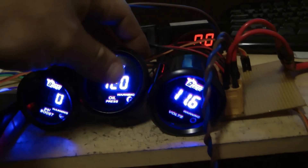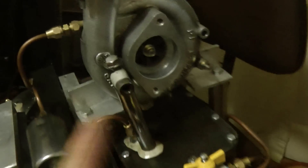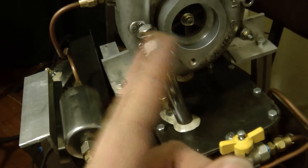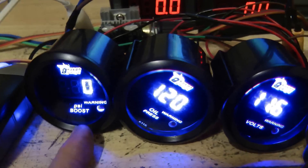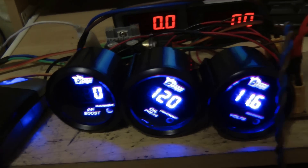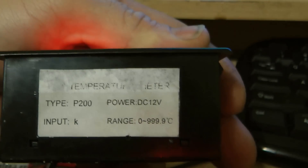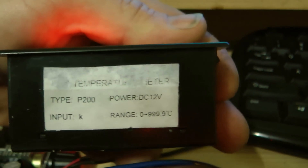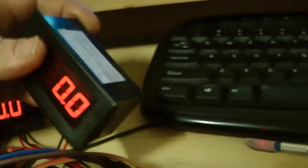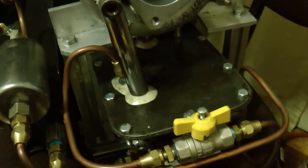So I've got oil digital, voltage digital, and boost gauge. I thought boost is good because the old-fashioned ones fluctuate and pulsate. These have sampling — they sample every couple of seconds and average it out. Some great temperature gauges here — it's a K-type temperature probe and they read up to 999 degrees Celsius. If your jet gets any hotter than 700 degrees, especially a turbine this size, it's too hot. If your oil gets above 100 degrees, again, too hot.